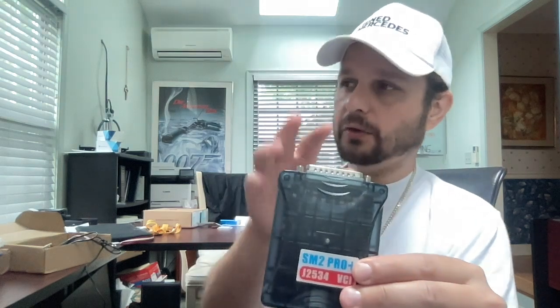PCM Flash comes in two versions: original and clone. The original hardware can work on both a clone PCM Flash and the original PCM Flash. So the clone hardware can work on the original software, and the original hardware can work on the hacked or cloned software. You'll see people who want original PCM Flash for better support or newer cars running a clone of the hardware. Sometimes vice versa — people might use a clone PCM Flash for cars they don't often use, while keeping purchased protocols for their main vehicles. You can use an original Scanmatic with the clone software.